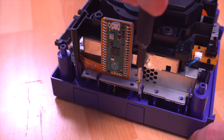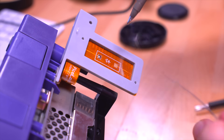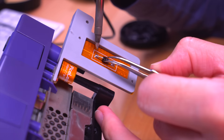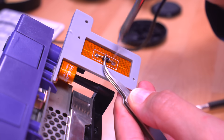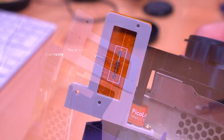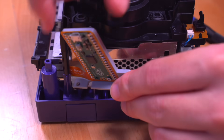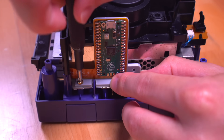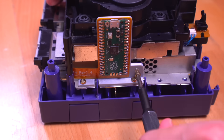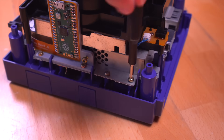Next, we'll remove the screw and pivot the bracket over, then re-secure it again with the same screw. This gives us access to the other side of the ribbon so that we can now solder in the diode. Once complete, go ahead and remove the screw for the last time, and then fully secure the bracket with two screws. The extra remaining screw can be secured here as well, which is great as I do hate having extra screws just lying around. Now we can go ahead and start to reassemble the GameCube.